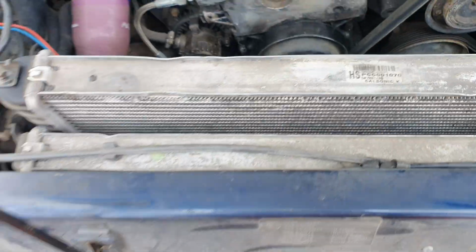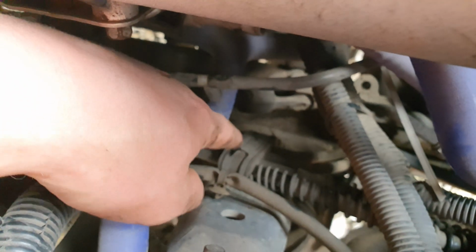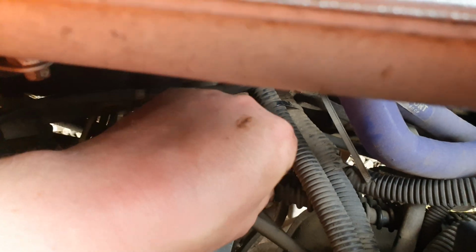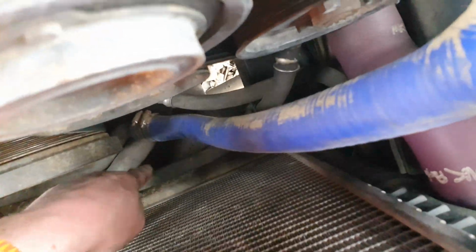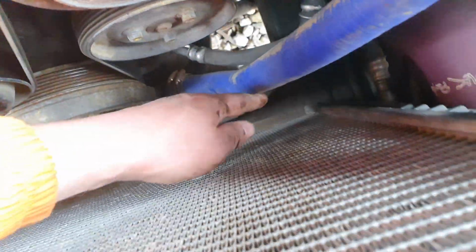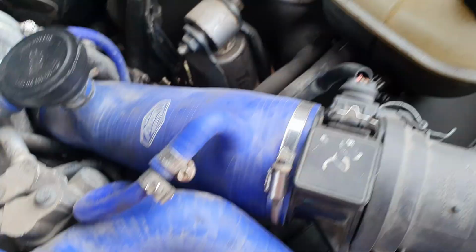Right, so looking at this, come round here, you've got the main trunk in here for the Ace pipes for the front. Two of these, ones with this black plastic coil, go to the Ace ram, and then the two further down loop round, which are these two here. So we need to undo that nut. Another one here. This big one comes up into the Ace pump, and then the one underneath it goes to your reservoir.